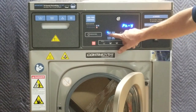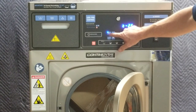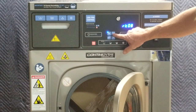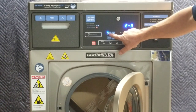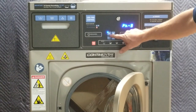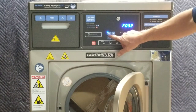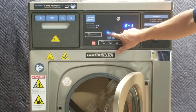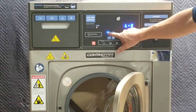Phase five is yes — again high level, 95 degrees. Dose one is fine, 25 seconds, no second dose. Agitation high, rotation time seven minutes, rinse hold none. An intermediate extract is probably a good idea — two minutes is fine. Phases six and eight we'll turn off. Phase nine we'll use and make modifications: high level, 32 degrees because it's a rinse, no dosing, high agitation, six minutes, rinse hold, simple drain. Phase ten we'll turn off.